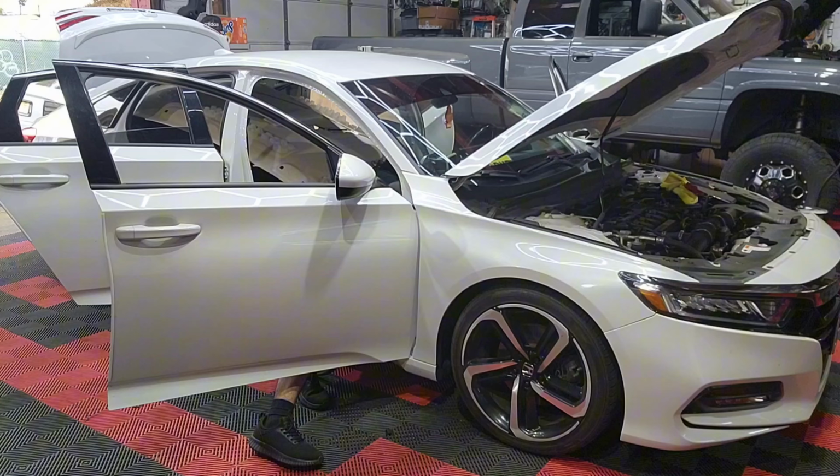You would think that after you remove everything that's holding onto the headliner, you can just feed it through one of the doors. No. I could be wrong, but I was looking in a couple forums, and I believe that before they put the windshield in, they fed the headliner through the windshield and then put the windshield on top. So this is not meant to come out through any door without bending it. Here's a time lapse of us struggling to get it out because we couldn't figure out how.